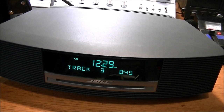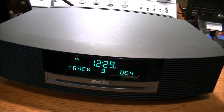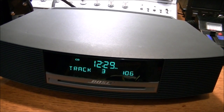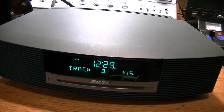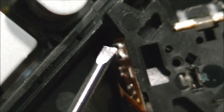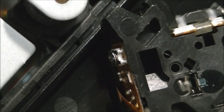I'll turn the trim pot clockwise to put a little bit more voltage into the CD player. By then the unit will be cooled down again — if I put in a CD and it starts playing right away, the adjustment worked. Just in case anybody's wondering which trim pot I'm turning clockwise, it's right here where the screwdriver is pointing. You'll need a small screwdriver. Turn it just maybe three or four degrees to the right. Now we're reassembling to see if that takes care of the skipping.